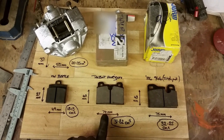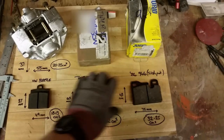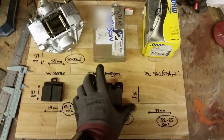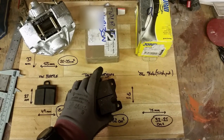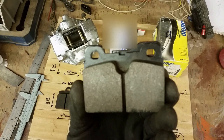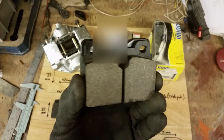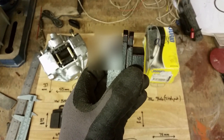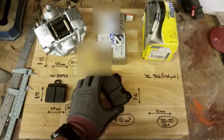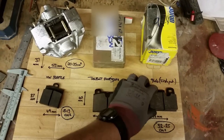It's literally a 1mm difference in the width, so it's probably nothing - just a manufacturing difference. If you put them back to back and line them up carefully, the holes line up. The Porsche ones have elongated holes, so I don't know if that causes an issue in terms of interchangeability. The only difference I can see is a difference in the thickness of meat that comes on the pad to start with, so I'm not sure you could put the 944 in a Horizon caliper, but it might go the other way around.